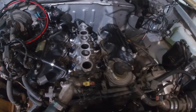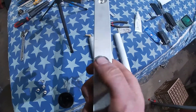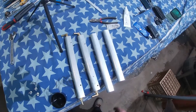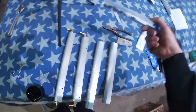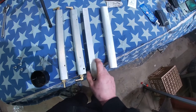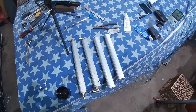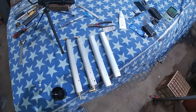Alrighty, I'm back. I've had a couple of days to think about what was going on here and came to the conclusion that the holes I drilled in here were just a touch too big, so fuel was getting pushed past the o-ring. So I went and bought another length of rail, chopped it to size already, it's all marked. I've bought a new drill bit that should be bang on the right size. I've got to do a bunch of drilling on these, tap the side holes, drill a couple of different size holes in them, tap the ends. I'll quickly smash all that out, put it back together, see if it leaks, and hopefully have this thing running by end of today. So stick around.